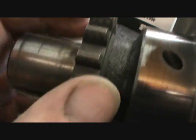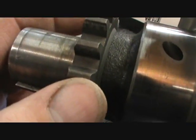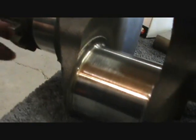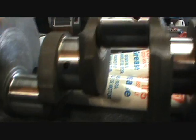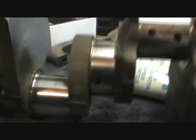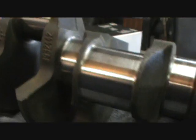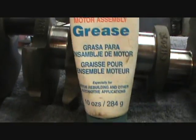And here's another thing. Look at that gear. That is the factory timing chain and gear. I mean, actually, if I wanted to, I bet you I could put the original one back in, other than the fact that it's a neoprene. And where did I see it? The date code on this crank is, let me see. H20 of 77. So yeah, I've been thinking wrong. This is a 78 motor. Yeah, duh.